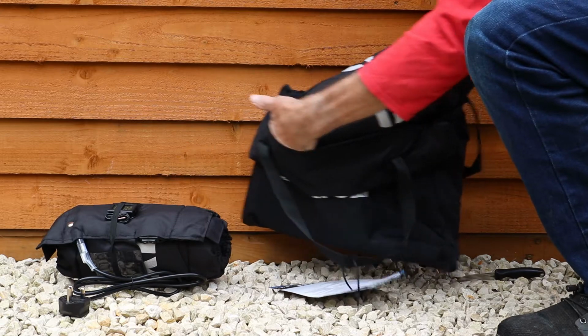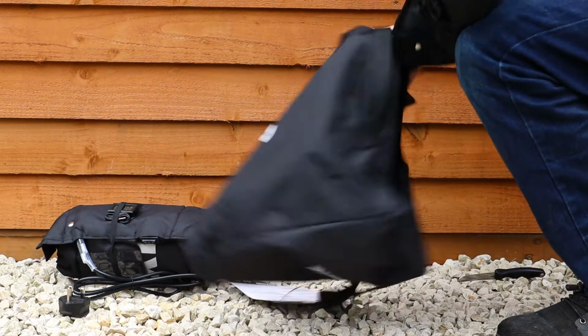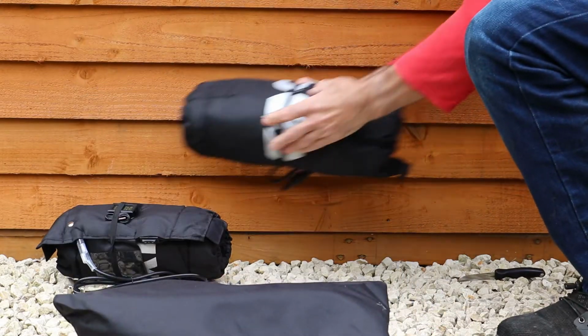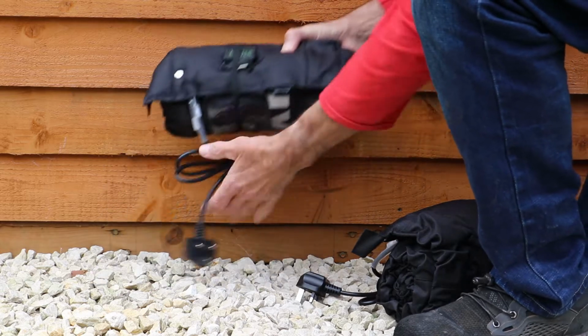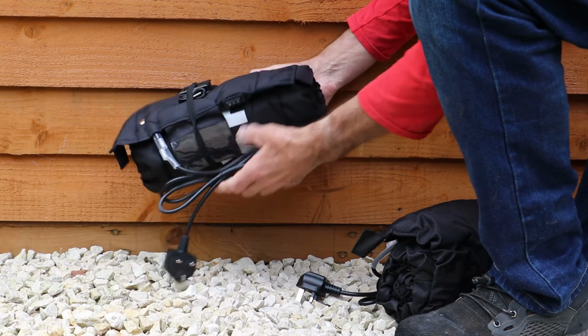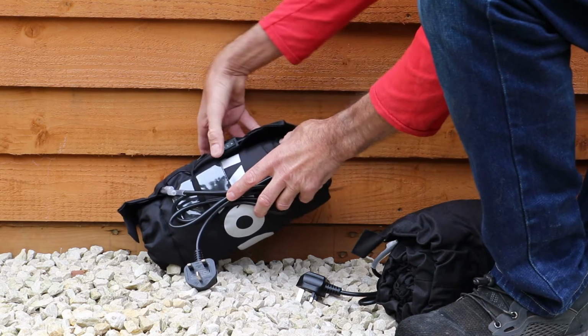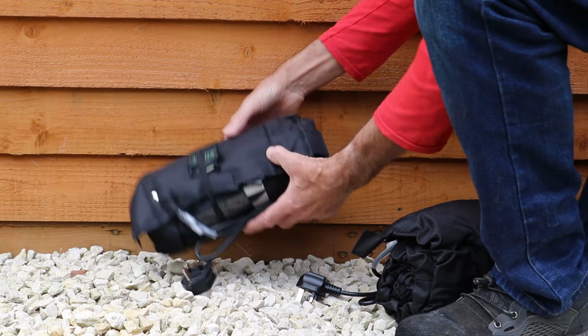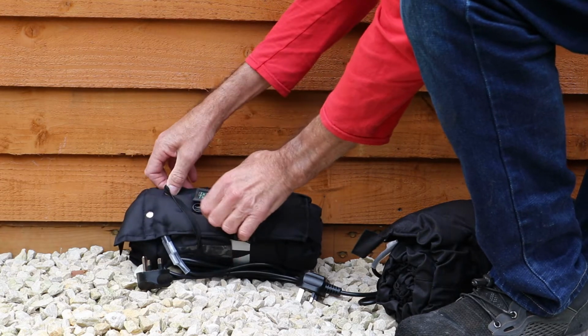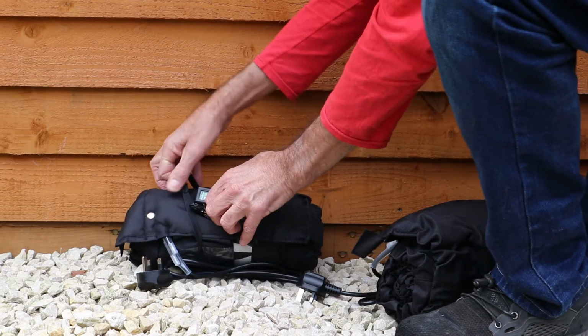What we get is the 2 tyre warmers, the smaller being for the front and the larger being for the rear. There's also a handy little carry bag, but on my last set the zip broke the first time I used it. Each warmer has its own mains lead with 2 LEDs to indicate the power status and a UK 3-pin plug. There's also the 3-way selector switch marked low, medium, high, and this rather cheap LCD digital temperature gauge, which is always on. If it's not displaying, it just means the batteries are flat and they need to be replaced.